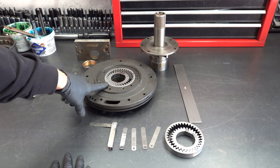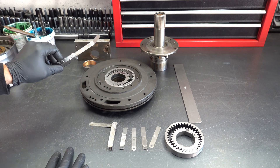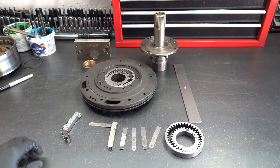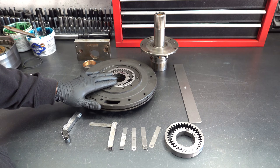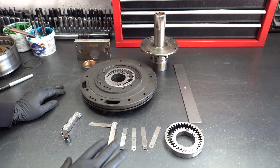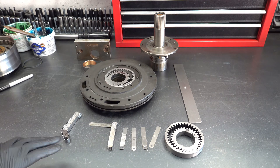Right here is going to be about as wide of a spacing I can get between the outer diameter and the inner wall, and this went about maybe a quarter of the way through and then stopped. So I'm going to assess this body to be good with these gears — four thousandths clearance all around the perimeter. And then I would guess somewhere between one and a half and two thou of clearance between the gear faces and the deck surface, maybe less, because I know three thousandths would not fit at all anywhere along the face. That's kind of what you want to see.